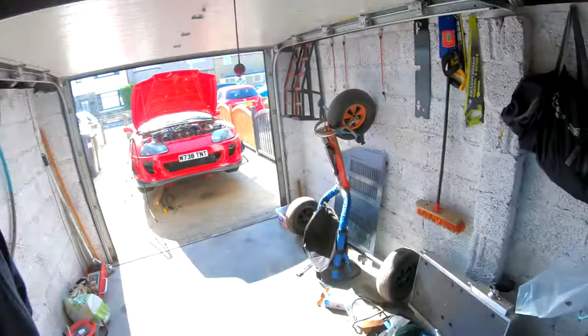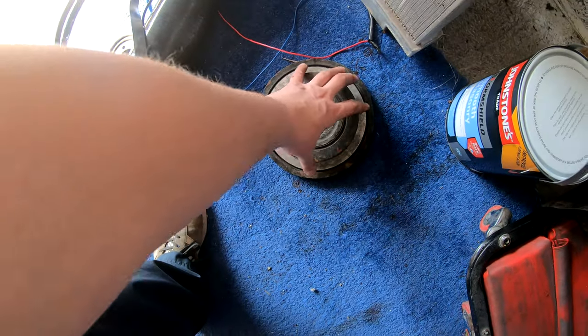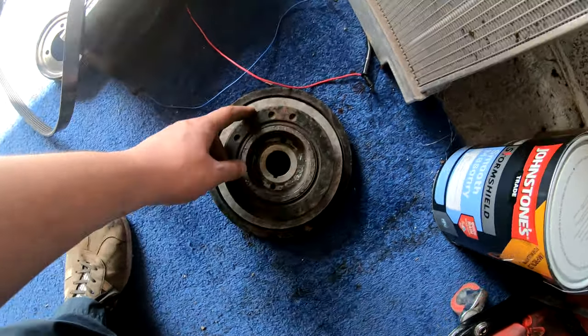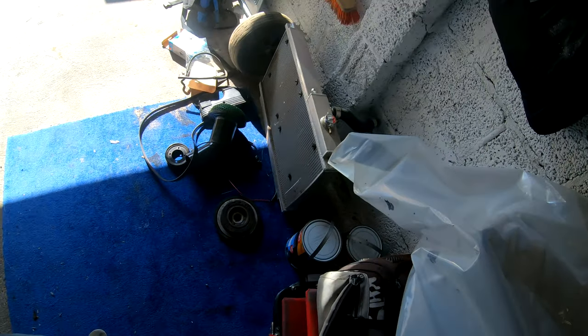That was a pain in the ass. I put the puller in the wrong place to start with — I put it on this edge thinking it would just pop out, and ended up snapping off a little bit of the harmonic balancer. That's not good because, as the name suggests, it's a harmonic balancer, so now it's going to be unbalanced. I don't have a spare for the moment so it will be going back on, but I will be getting a new one. That is the transparency of my channel — I will tell you when I mess up.